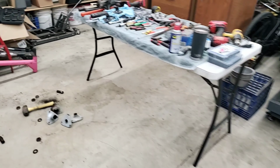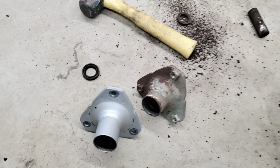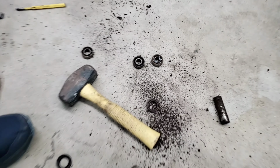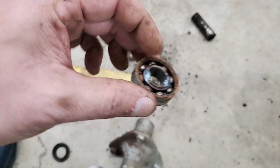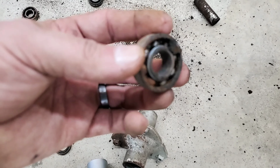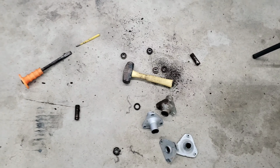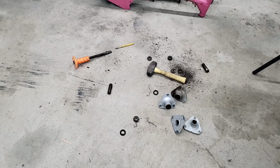And then I thought, shoot, I got to get these ready for powder coat. So I was attempting to remove the seals and bearings out of these, and I forget who told me the trick. This was rusted in, and somebody told me, I can't remember, put a bead of weld on the inside race, and it will loosen things up. It'll shrink the metal, and it did. So the bearing puller actually wouldn't work on those, so I did have to pound them out.